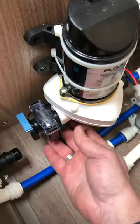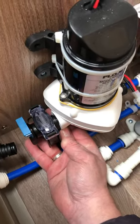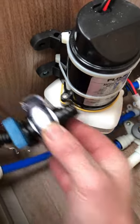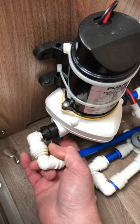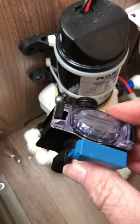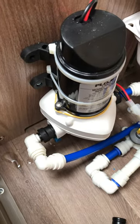There's another blue clip underneath and sometimes you have to remove the pump to get to that — it can be a bit of a fiddle. Pull that down, then the filter comes out, and with the extra play you can push into that. Push the blue pipe up and that's taken the filter out of the system, then you can test the pump and see if that makes any difference.